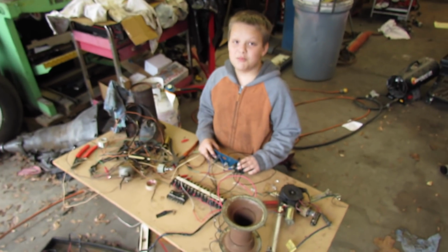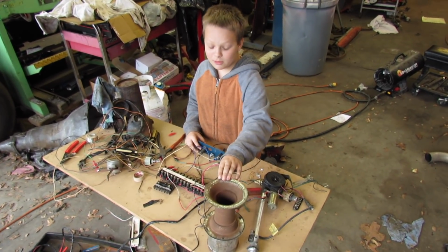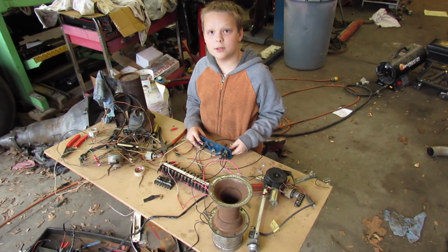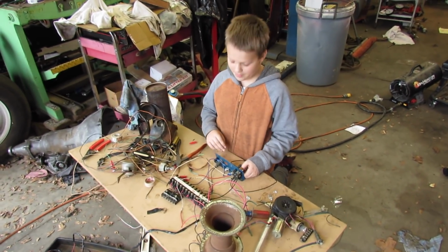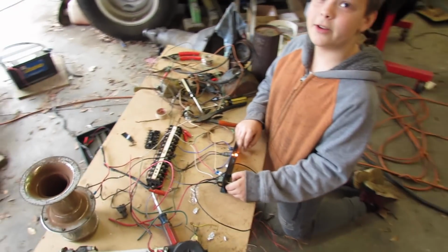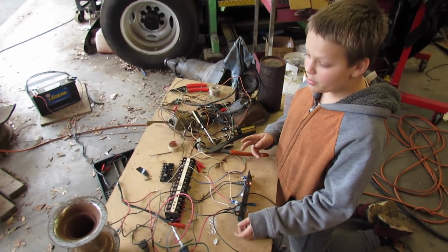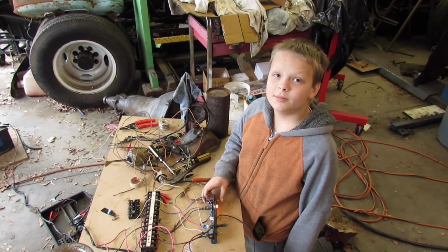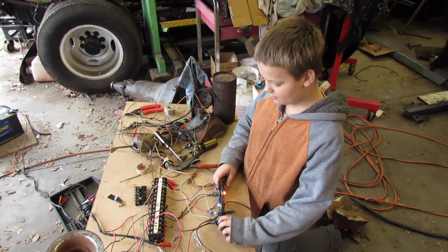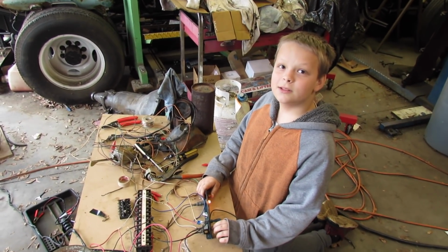What you got there, man? A problem. What is it? Well, I was gonna give you a little jump here with the horn, but it wasn't working, so I was taking a look why. Looked at all the wires, so it's all connected and everything. But with my handy dandy little check light, when I switch the switch on, it gets dimmer. Which means the battery doesn't have enough electricity going through it. So the battery right there ain't no good. Wow, that's quite a deduction. And you're probably right. You know what Sherlock Holmes would say? What? Elementary, my dear Watson.